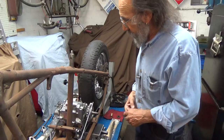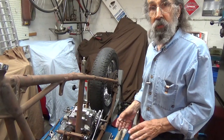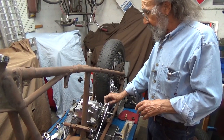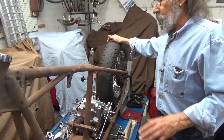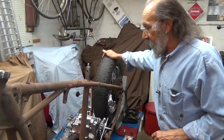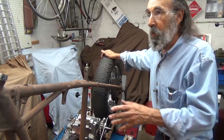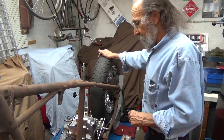As I recall, it's a real nice transmission. Basically a stock transmission — no close ratio gear set or anything, just stock. Which is probably ideal because I've got the whole thing geared so high with a huge transmission sprocket and the belt drive I want to use and the tall tire profile I want to use, that's going to gear this motor real high. By using a stock gear set in the transmission, it will give me a nice low gear to get this thing rolling down the road, because I'm really more interested in long range traveling, keeping the RPM level down as we've discussed with gear ratios in the past.